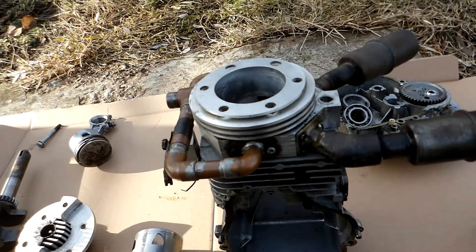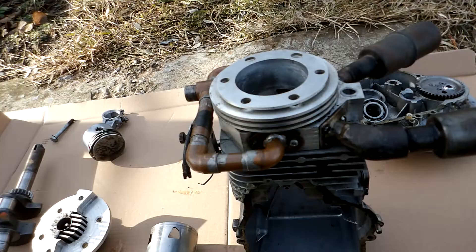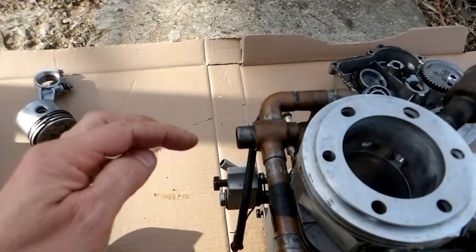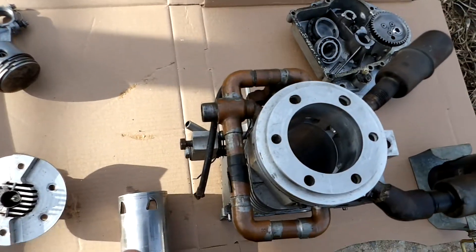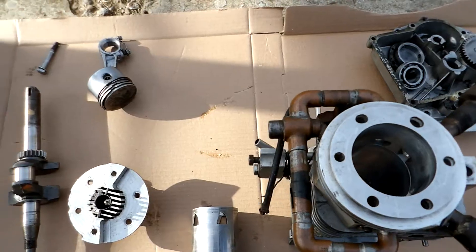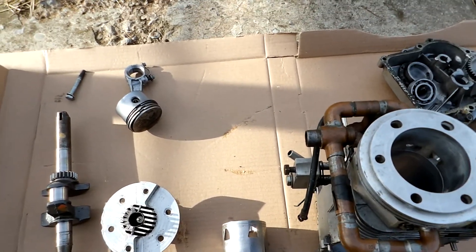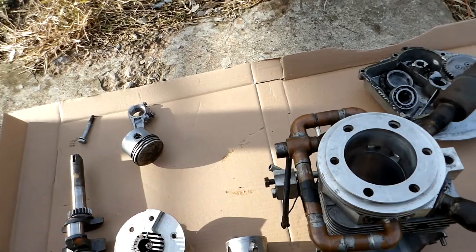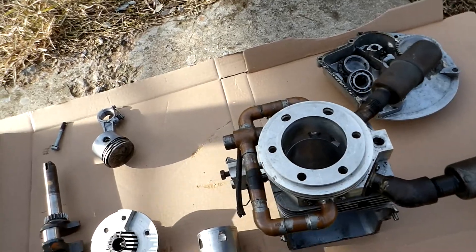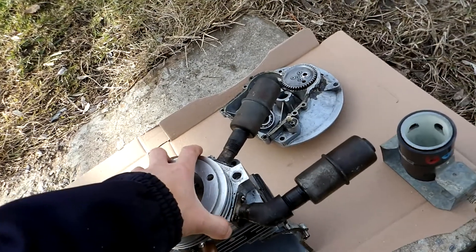It worked — made about four and three-quarter horse at 3200 rpm. The intake manifold surely wasn't helping matters, and the stock Briggs lawnmower carb wasn't ideal — I should have gone with a Tecumseh adjustable float type carb. But I stuck with the gas tank carb combination from the Briggs so I could actually cut the grass with it, with the governor hooked up. Some of my videos do show me cutting the grass.